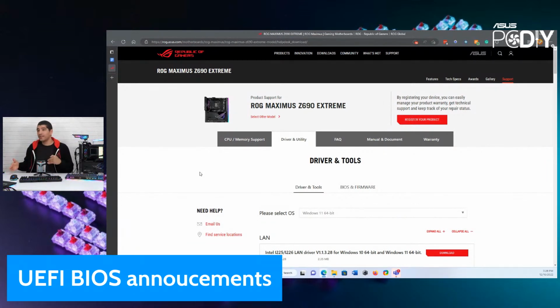So if you do update to some of these latest releases, this is important for Z690 owners that might be adopting 13th gen, or even if they're not adopting 13th gen, but they decide for whatever reason they want to update their UEFI, as some users do, make sure to follow these steps. Update that UEFI firmware, then update the management engine, and then update that corresponding driver. Okay, so that should pretty much take care of that.